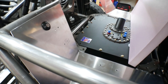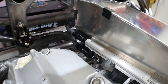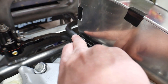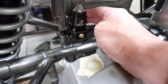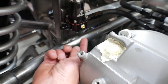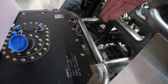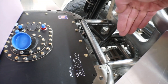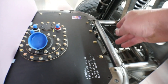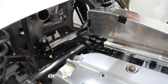I've already started working on the fuel system and have some video segments of that for a separate video. I've plumbed into the fuel rail and have a line coming over to a fuel pressure regulator. I'm going to have a supply line and a return line. In a cavity I'm planning, there'll be a piece that sets down in there with a pre-filter, the fuel pump, and a post-filter — it'll take from the tank, go through the filters and pump, and then make its way to the regulator and into the fuel rail. I haven't ordered all the parts yet, so that'll be a separate video.